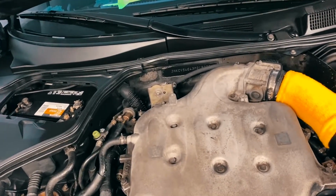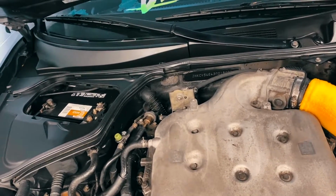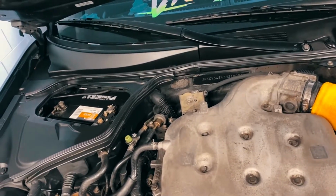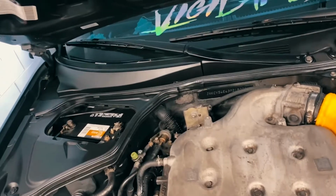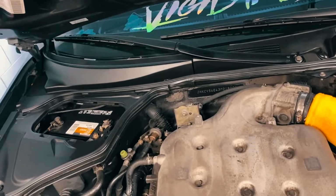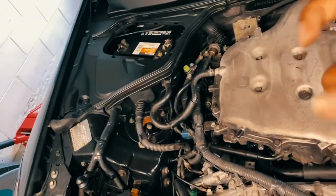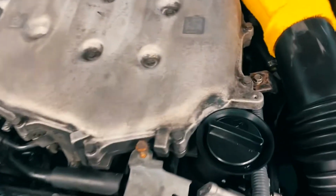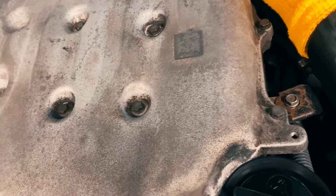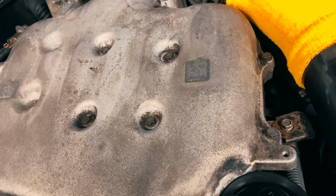Even more noteworthy, the socket for the spark plugs, usually around number 2, sometimes 6, but again, it may go out on any one, but usually around the 2nd cylinder or so, the actual ring, there's a little rubber grommet type of ring that's supposed to stop any oil or anything from going into the actual cylinder on the spark plugs, that literally dries out, it rots out, and that's it.